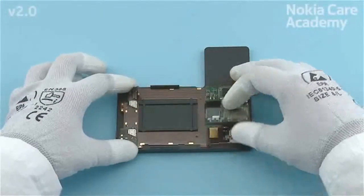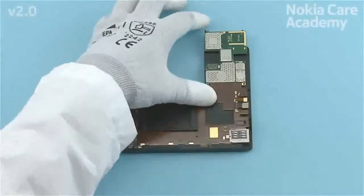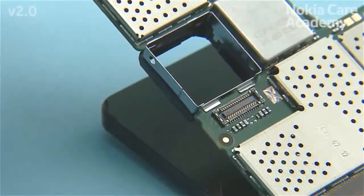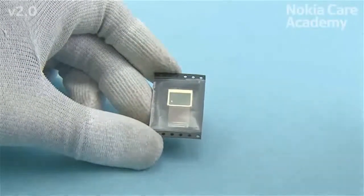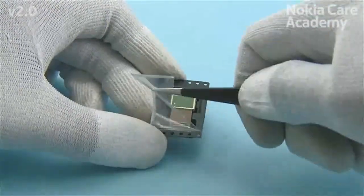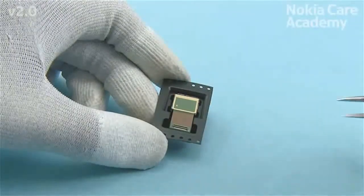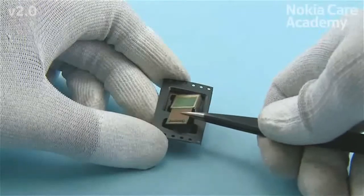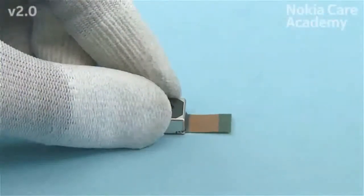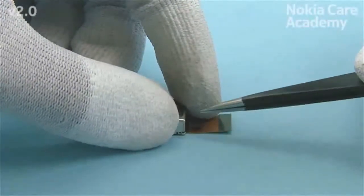Place the engine board including the main flex on the Care Chassis assembly jig and turn over the engine board as shown. Place the camera boot. Remove the camera from its packing. Place the camera connector support to the camera flex and press down gently to activate the adhesive.